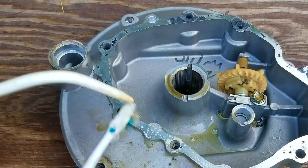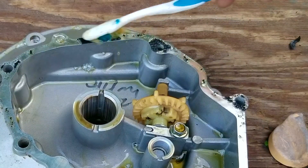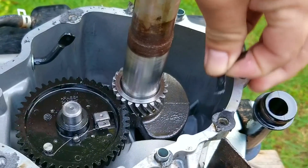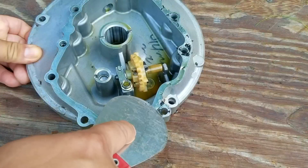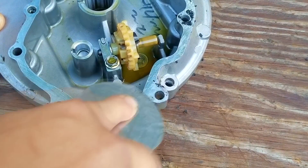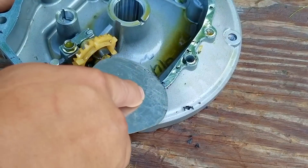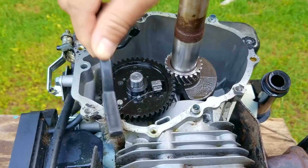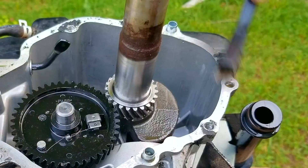To help get the old gasket off I'm going to use some old gasoline. Next I'll remove what's left of the gasket on the block — same story here as the sump. I'll remove the larger pieces of broken gasket and then soak the remaining bits with gasoline to soften them up. After a few minutes I'll come back and scrape off what's left. There are better ways of doing this, so if you prefer, use your own technique. I'm using old gasoline because it was free — taken from a project generator several videos ago — so I needed to find a use for it.